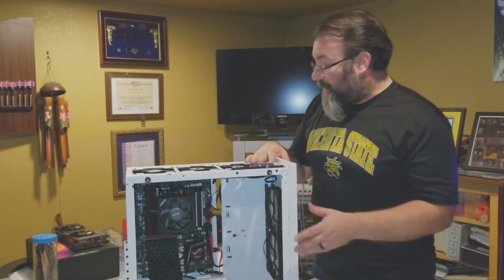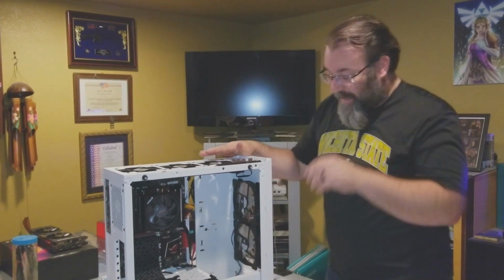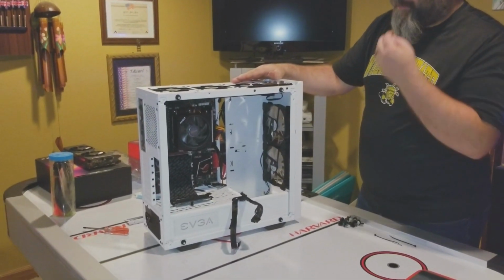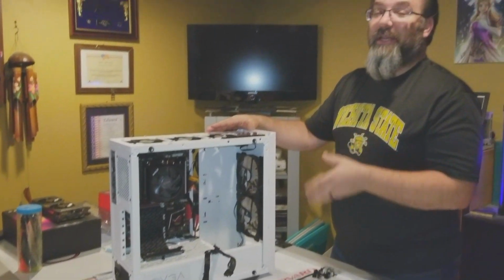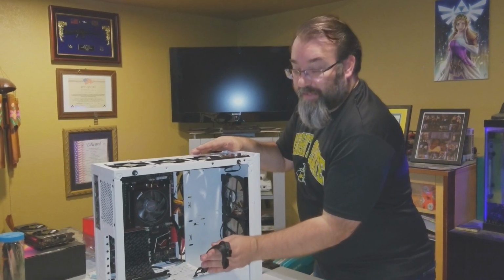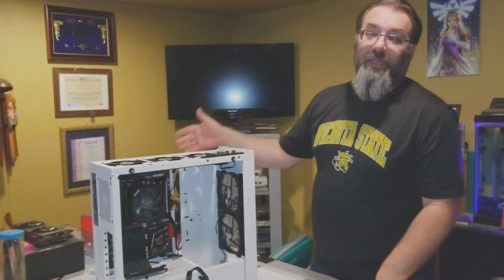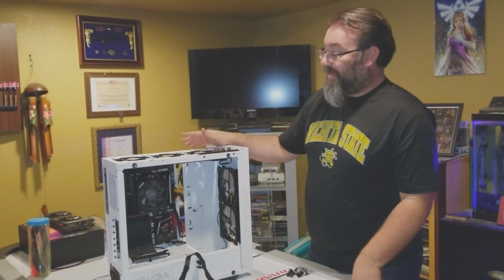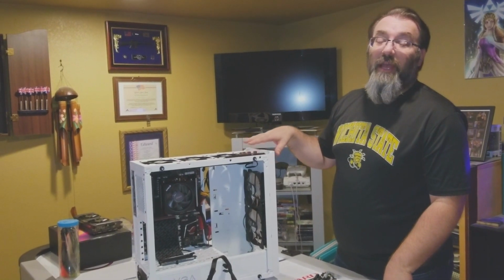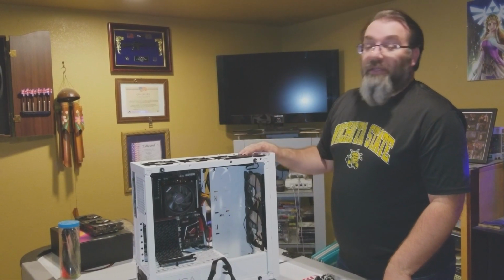So let's finish up what we got going here. There's not a lot left. We're almost done, you guys. Like I said, I went ahead and routed the power supply and got the cables connected that I know I'm going to need. There's very minimal cables that I'm actually going to need on this power supply. The only thing I needed was the 2 PCI Express power connectors and that add-on cable for the serial ATA drive. Now that's also powering that serial ATA connector for this RGB header here. If you remember right, this required 1 connector on there to power everything. So that's good to go there.